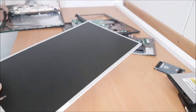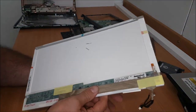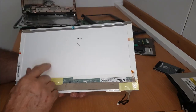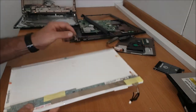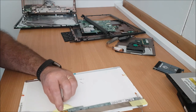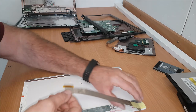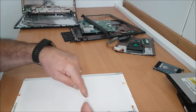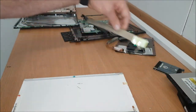I'm just going to show you something on the screen as well. On the screen, on these, they've put an extension ribbon on. So if you bought a screen for this, you'd have to be careful, because you'll have to pull this tape off carefully. Depending on what it is, 40 or 50 pin — and then this just pops out. The same with the other side, just slide the tape off. So you'd need to keep this — if you bust this screen, do not throw this ribbon away, or you'd be paying £12 to £15 for one of these ribbons as well.